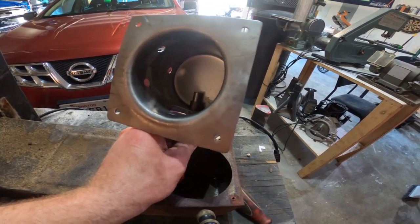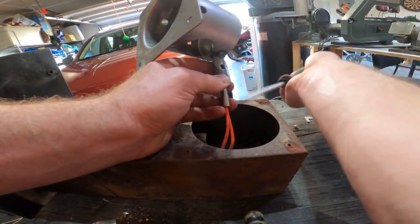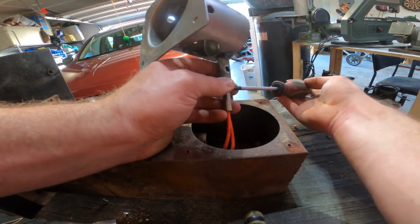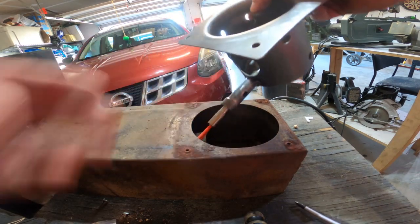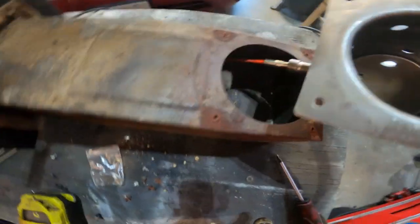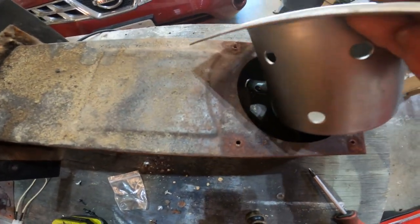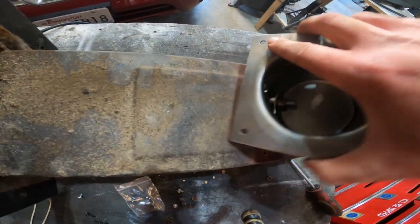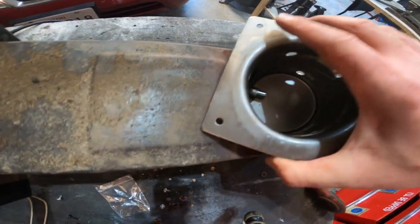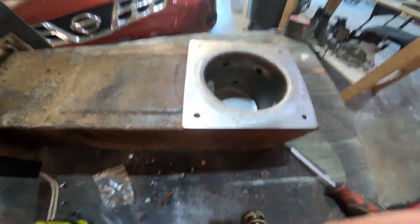I've got my hot rod poking out through here. You want this thing to stick out a quarter to half inch — that's probably about good right there. It doesn't need to go all the way out. Once you've got it set, take your screwdriver and tighten up the set screw to hold it in place. When you put this back down in here, make sure the wires go underneath the tube down there. Put it down at an angle — you're going to have to play a little bit. Then line the holes up top and put your four screws back in.